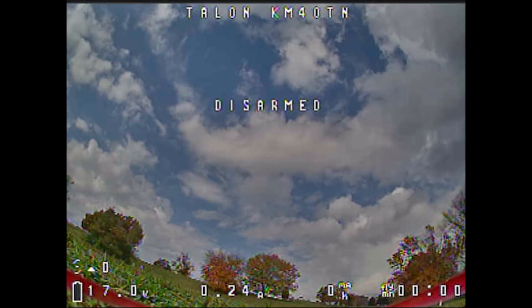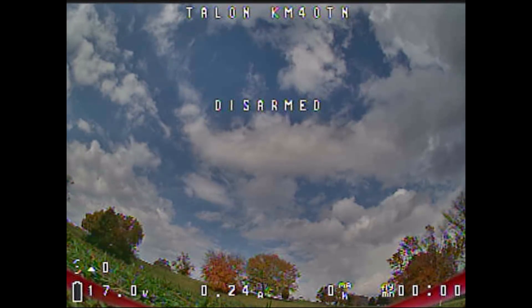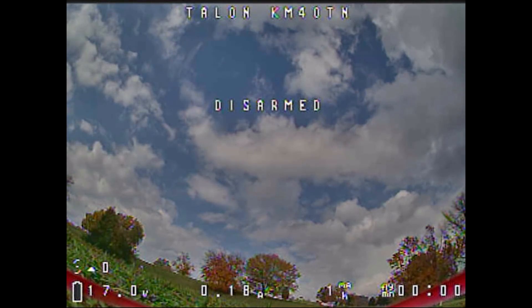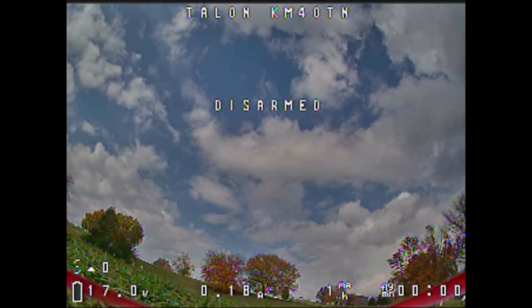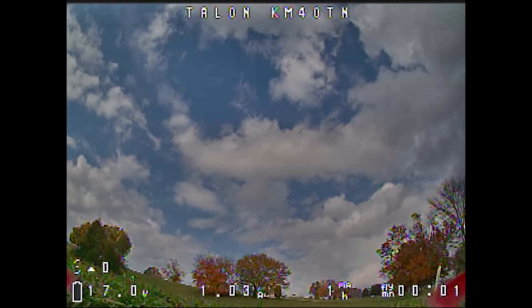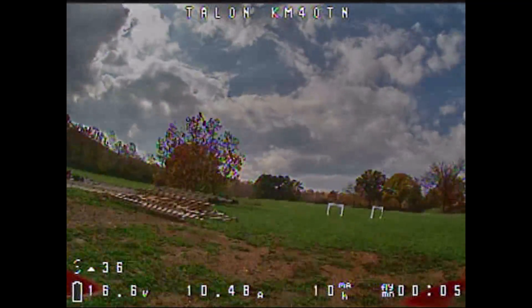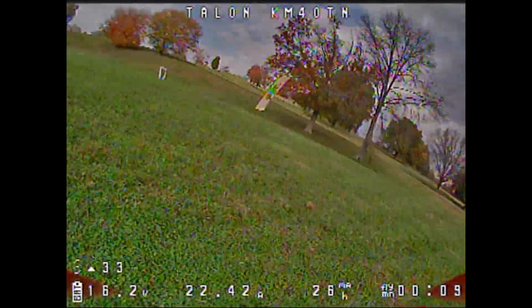In order to let the camera make the best first impression it can, I need to tell you this is not quite in its stock configuration. The camera comes from the factory with the sharpening level set to a 6 on a scale of 1 to 15. I've turned that down to about a 3 or 4, which I feel cleans up just a little bit more of the digital noise without over-softening the picture.